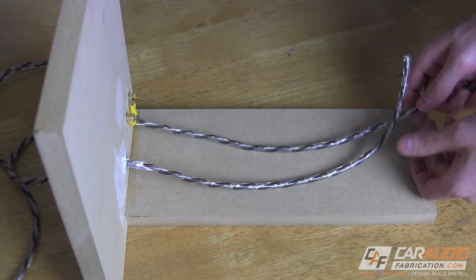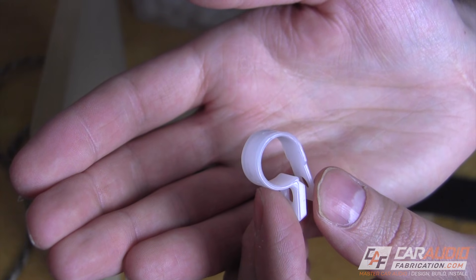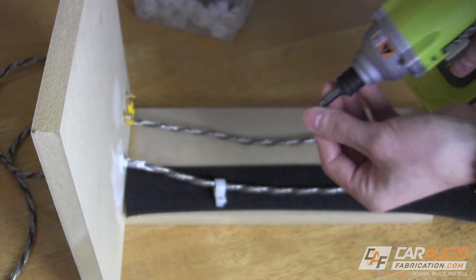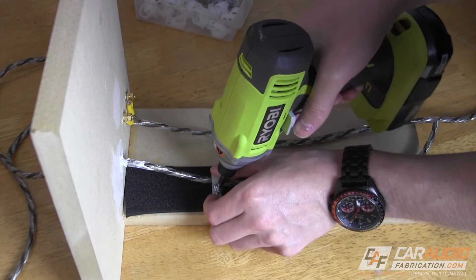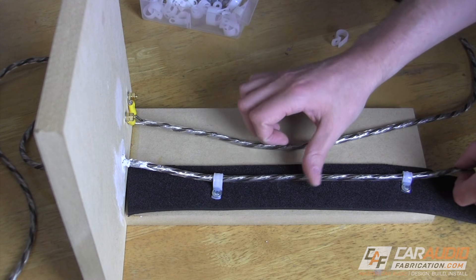The third thing we need to address is: once the wire is in the box, how do we manage that wire while it's connecting to the subwoofer? The most common thing is that the wire is simply dangled inside the box heading over to the subwoofer. The problem is there's potential for that wire to actually bounce against the side of the box, which you might recognize as a rattling inside the box. To better run the wire, I recommend laying down a strip of closed cell foam, then using flange head wood screws to secure the wire connector through the foam into the wood. This results in a wire that no longer makes a rattling noise.